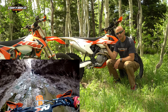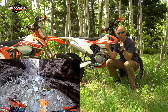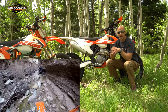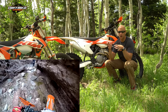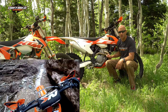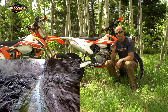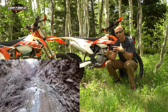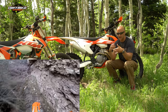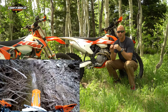This bike right here, KTM 350 XCF, has electronic fuel injection. It's a throttle body fuel injection, so it's not directly squirting fuel right into the cylinder like it would on your car, and it's also not quite as efficient as the one on your car. On your car, your electronic fuel injection would have an oxygen sensor — or multiple O2 sensors — out on the exhaust to monitor the actual fuel burn as it's coming out of the cylinder, and that allows those engines, because they have computers and sophisticated calibration, to really make your car run more efficiently.